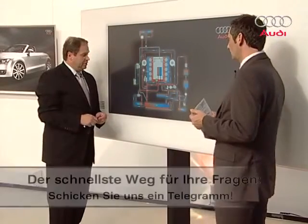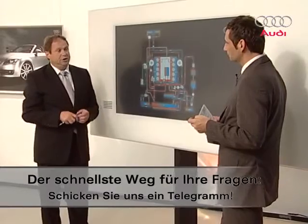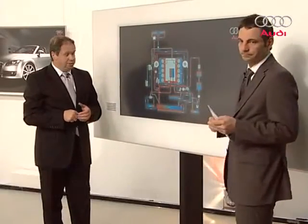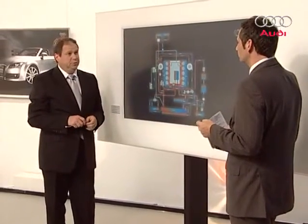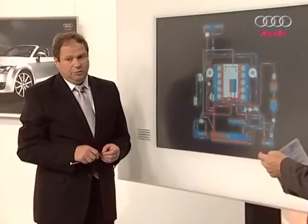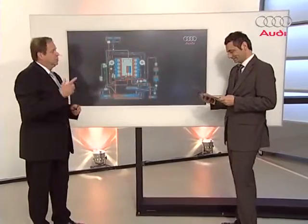Where is that in the car? The filler tank is in the engine compartment — you can see the blue lid that everybody recognizes from filling the cooling system. The expansion tank is hidden under the right-hand wing panel, but in the A-pillar of the front passenger's door you can see the coolant levels. From the display window you can see if the filler tank is sufficiently filled. In daylight you can see it is filled with pink liquid, so you can see from the outside if the expansion tank is full.